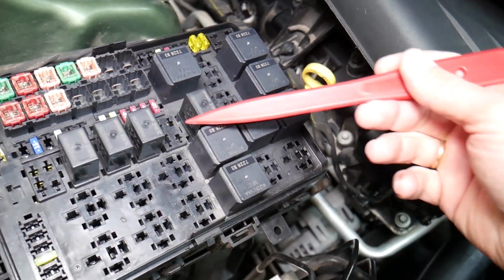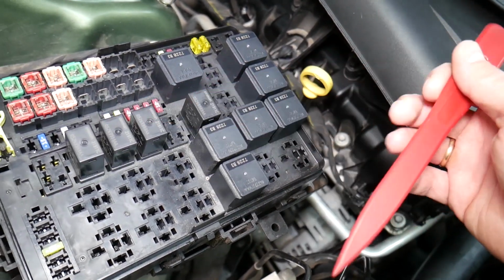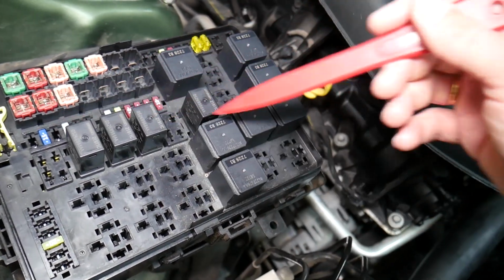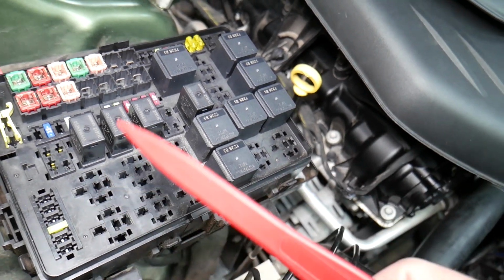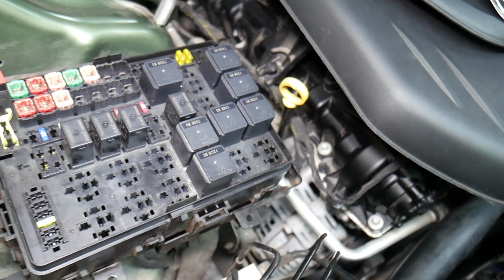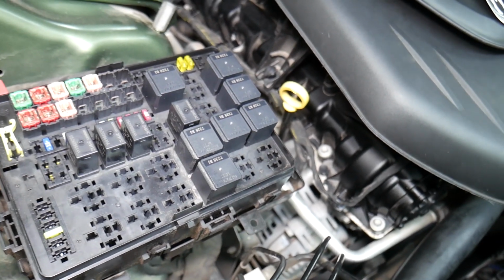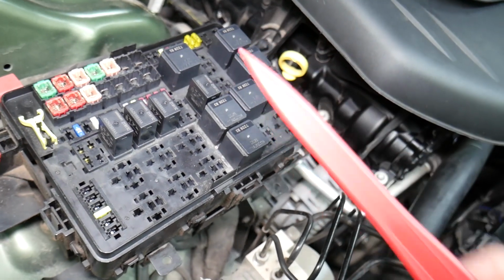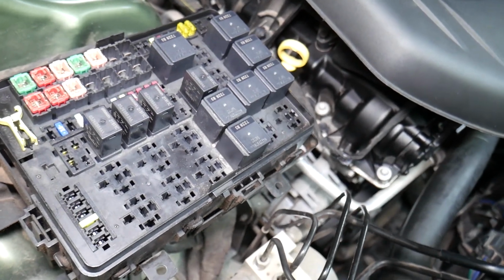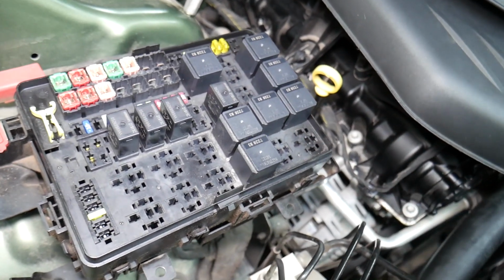The same thing for relays, guys. Some of those could be really expensive on cars, so we'll put a link in the description of the video below on how you can test relays. And for some certain fuses, guys, it's important to disconnect the car battery when removing them, otherwise you can burn the electronics. For instance, when working on airbag fuses, or anything like that, you need to wait at least 1 hour after disconnecting the car battery. And if you're not qualified and certified to work on the airbag system, I will never recommend doing that, guys.